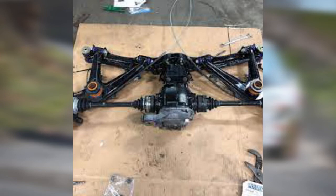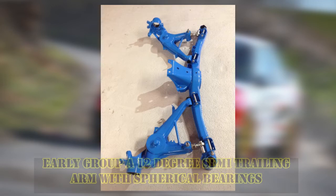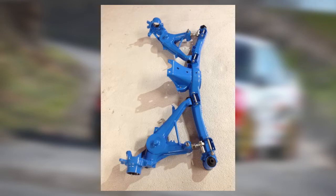That is why for Group A competition, BMW Motorsport introduced a modified semi trailing arm outer pickup point that reduces the sweep angle of the rear trailing arms. Hence the camber and toe curves are reduced — or for easier explanation, there is less alignment change with this setup — and this greatly helps in keeping the rear suspension from being unstable.